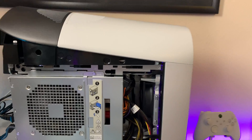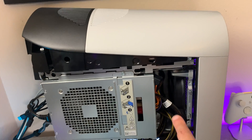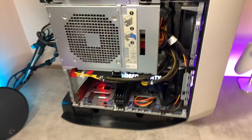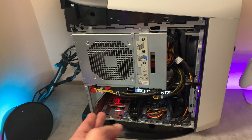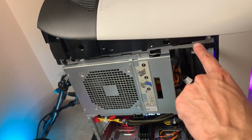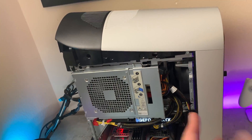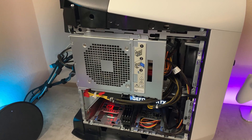This has been a long process because I got sidetracked with the GPU thermal paste work and took a break. What I find extremely interesting is that where we installed this aftermarket fan — where there was not a fan by default — all it's doing is blowing on the GPU and two SSDs that you probably don't even have down there. The GPU already has its own cooling with two fans, heat pipes, heat fins, and a heat spreader. Over here you've got the PSU, the motherboard, RAM, and CPU — this is where you need a fan, Dell, not down there. Ideally you should have two intake fans like we now have, but honestly, that really is not a lot of stock cooling.